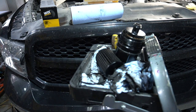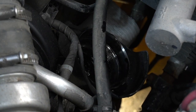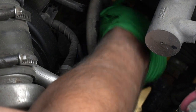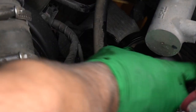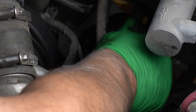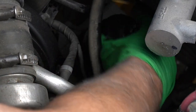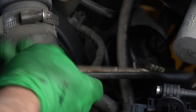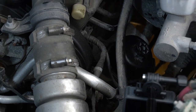Let's clean the cavity out where the filter lives. You can see there's still lots of oil in there, but it doesn't take much to dab it out. Be careful not to knock any dirt or gunk from the hoses or surrounding engine into that hole. Now we can reinstall the oil filter by hand, since it is just plastic — make sure it threads in easy and you're not cross-threading it. Thread it down until it's tight, then use the adjustable just to snug it a little bit more. Don't over-tighten it or you'll strip it. The oil is still draining down there.